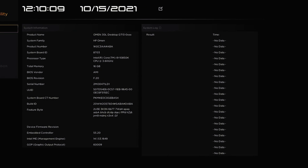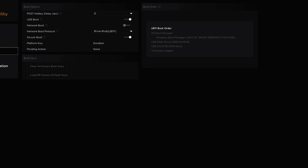To access the BIOS on HP Omen 30L, all you need to do is restart, and while it's restarting, continue to press F10 on your keyboard. After a brief couple of moments, you'll be presented with the BIOS and there will be a brand new menu coming on the left side of your screen. It's like the fifth item from the top, and it's going to be called Advanced. That menu only appears if you install aftermarket memory — if you have your original memory, that menu will not be there.